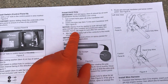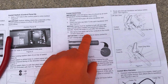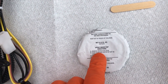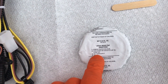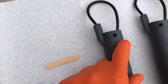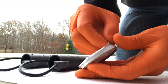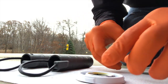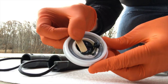Next it's epoxy time. This must be applied to both left and right grips and the grips installed within five minutes, because the epoxy will begin to cure within five minutes. On the actual epoxy package: step one, remove protective film; step two, push down on center to form a cup; step three, mix thoroughly using the little mixing stick; step four, apply. We will apply half to the inner portion of each grip.